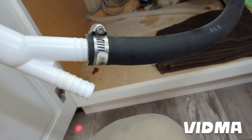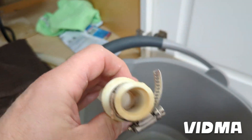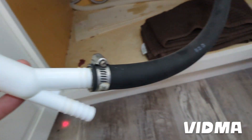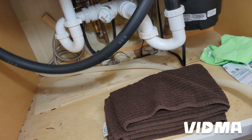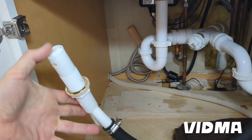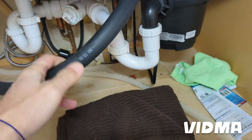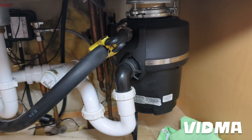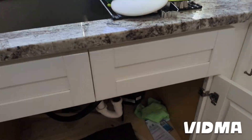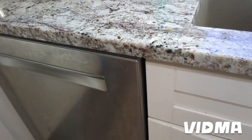That's why I took this hose off — sometimes something gets stuck right at this section. The cap alone is not a hundred percent, but if nothing is there we've got to go further. If this thing is overflowing, if you're getting water spraying out with the cap on, that means this hose is clogged. Sometimes you get a kink there, or sometimes it's just built up with oils and it will basically overflow. So you think it's a problem with the dishwasher but the problem is actually the return hose.